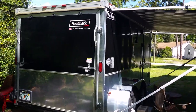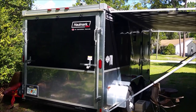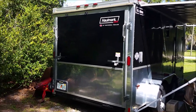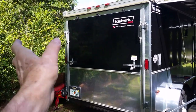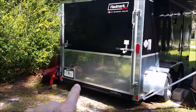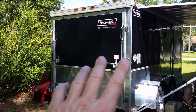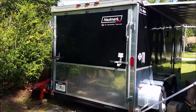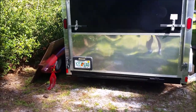This thing's built like a tank — it's absolutely wonderful. It's got a 13,500 BTU AC on the roof, and it's insulated. All that was done by the original owner. What I did is I took all the sealant off, sanded it down, ground it until there was no rust left, then I put Ospho wherever I knew there was rust — mostly along here — and repainted it with Rustoleum, then put a new seal around the whole thing. I also had it cleaned up underneath.